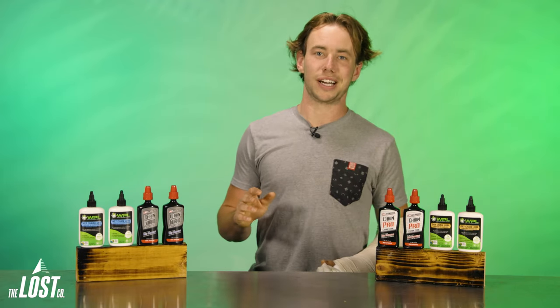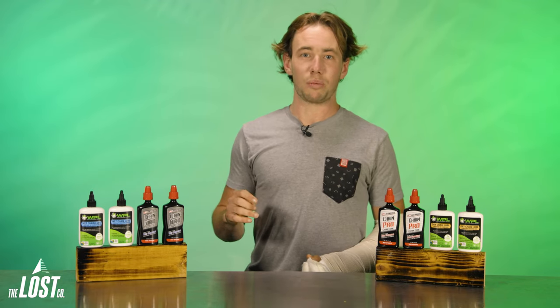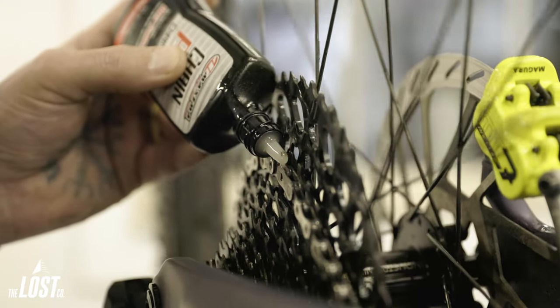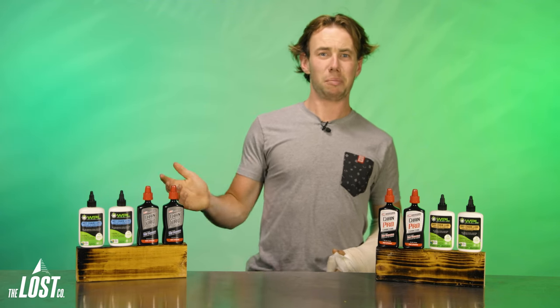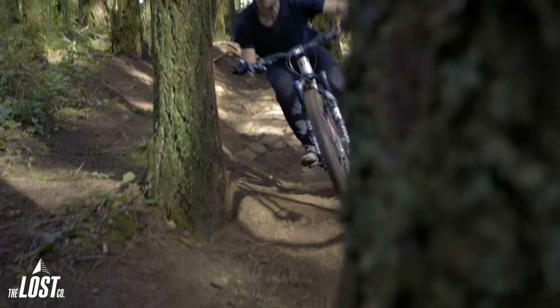But it's not all good news for dry lube and it's got a couple of downsides. First, because it's a lower viscosity lube, it won't last as long as a thicker lube. It also needs a few hours to dry out after you apply it before it can properly lubricate without picking up any dust from the trails. And if it rains for even a couple minutes or if you go through a deep creek, it'll actually all get washed away and you'll be left high and dry with an unlubricated chain.